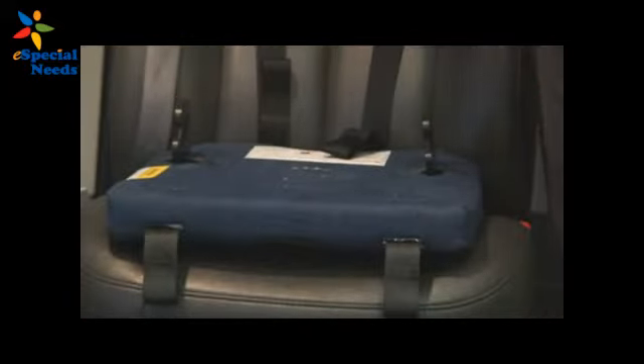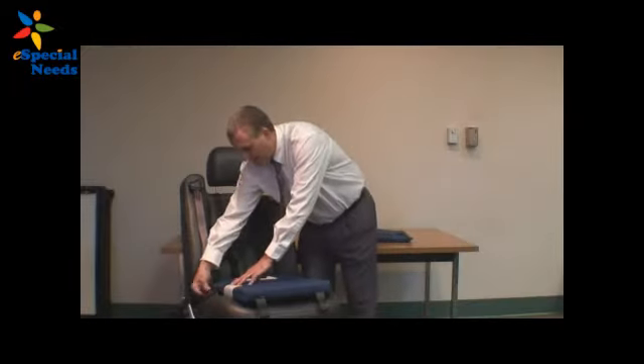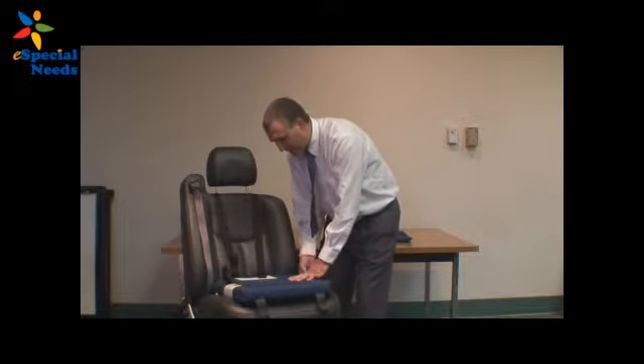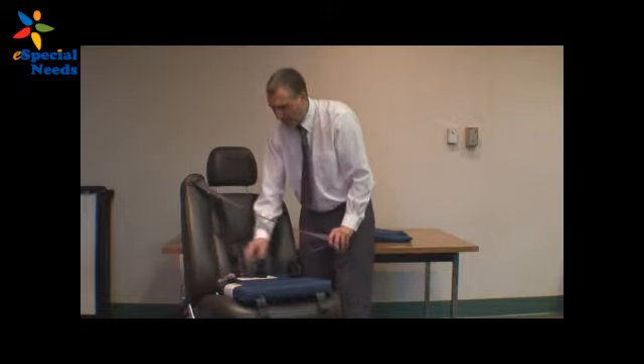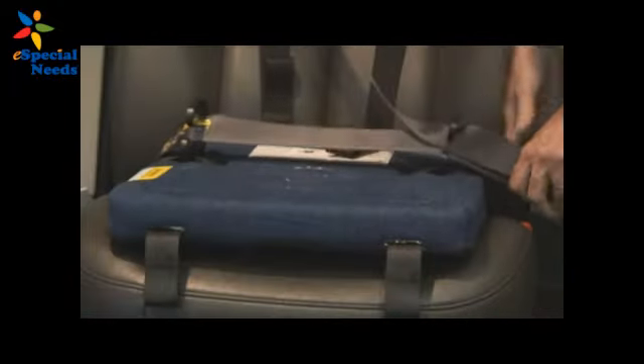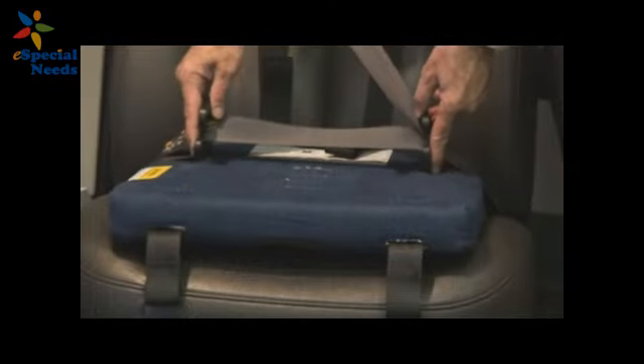We've talked about positioning with the Churchill, but now I'd like to talk about installing the child with the lap and shoulder belt, which is what you have to do every time. You really have to use the lap and shoulder belt — not a lap belt only. We have belt guides to position the lap and shoulder belt appropriately. If the child is big enough and positioned fine without the belt guides, you can push those off to the side. On the other hand, if the lap belt is high up on the child's abdomen, it's important to use these belt guides because they will position the lap belt lower on the upper thighs and hips. Put the lap belt into the belt guide on one side, and the lap and shoulder belt into the belt guide on the buckle side, then attach the latch plate to the buckle. You want these belt guides positioned right up against the child's thighs when using them.